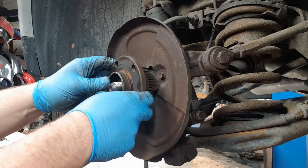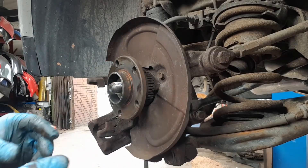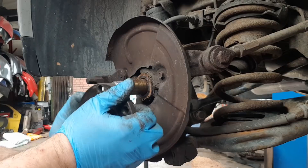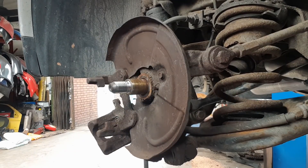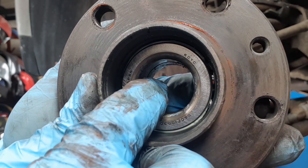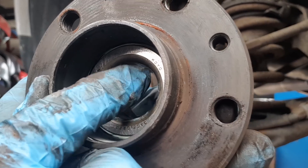There is a washer in there as well. Now your wheel hub is free to come off — sometimes they can get a little bit stuck so you will need to use a hub puller on them, but this one is fairly simple to get out. Now inside there you can see the wheel bearings, and there's a lot of play in there, so those wheel bearings are absolutely shot.